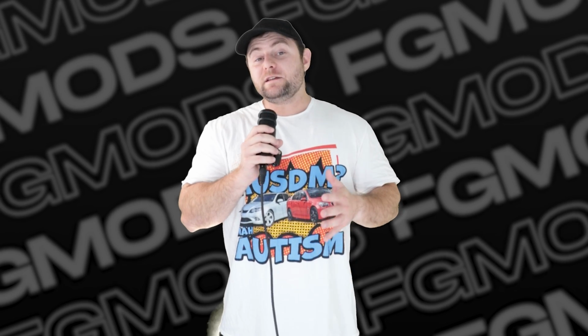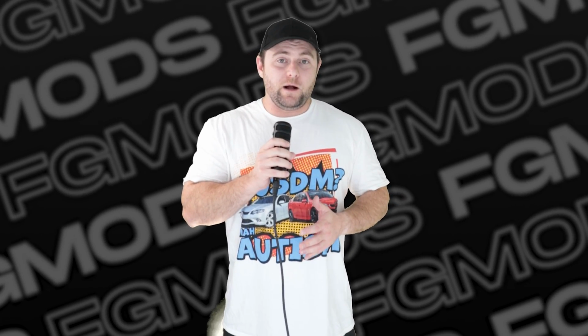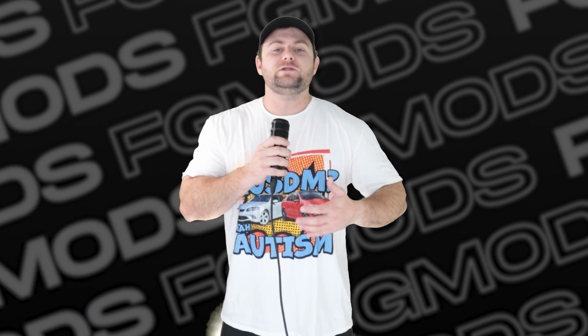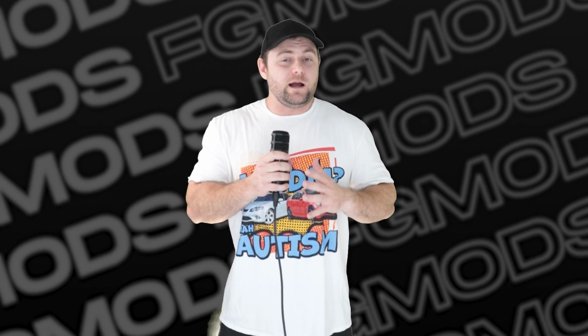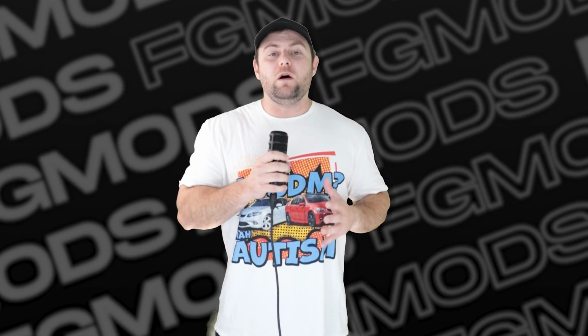At this point, it should be pretty obvious what causes these failures in Falcon fuel pump wiring and why it's almost always the connectors. It's because this is the area with the highest resistance. As the fuel pressure goes up and the pump has to work harder and harder to try and push the same amount of fuel, the amount of power being drawn goes up more and more, and these connectors become a bottleneck where eventually they end up being too hot, overloaded, they melt, they burn out.